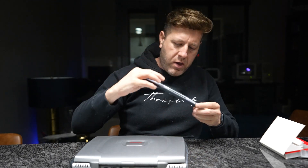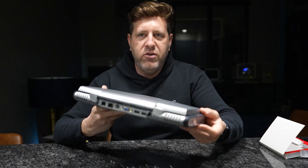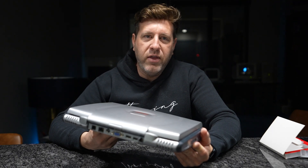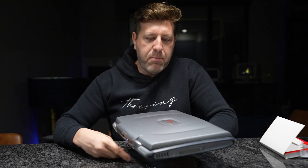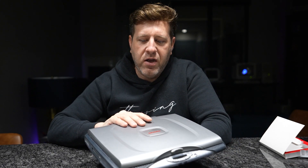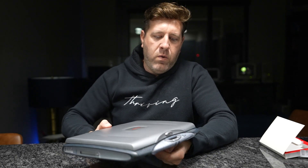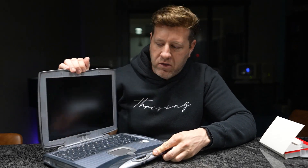These drives are usually meant to upgrade vintage computers. This machine is from the 2000s — shortly after this era the SATA interface came in, so anything pre-2000s, especially laptops, is solidly going to have a parallel ATA PATA interface. The main advantage of an SSD here is that it doesn't make noise and you get the absolute maximum speed the interface allows. Since I want to make this a vintage gaming laptop, it will be quick, noise-free, and less failure-prone with no moving parts.